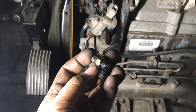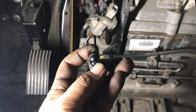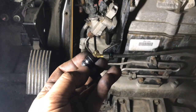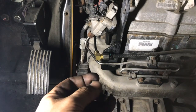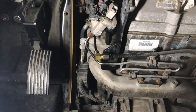This one is brass, and then you got a little plastic elbow press fitted into it with an O-ring. Well, this thing is real wobbly, so the O-ring is no longer keeping that seal, so air is escaping through there, somewhat rapidly. So now we replaced it with an all brass compression fitting, and that one should hold up a little bit longer than this one did. So, well, we took care of the air leak, so now let's go ahead and put this thing back together, put it back on route, guys. Let me go ahead and get that done.